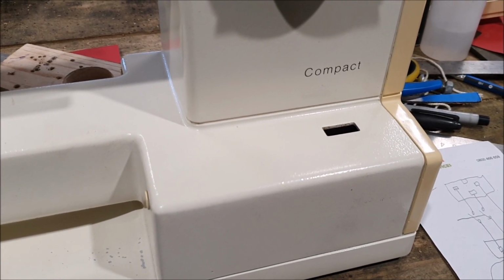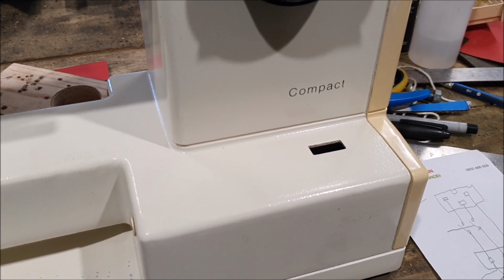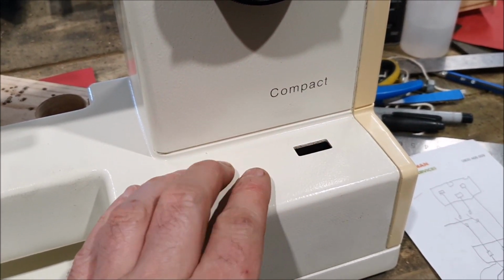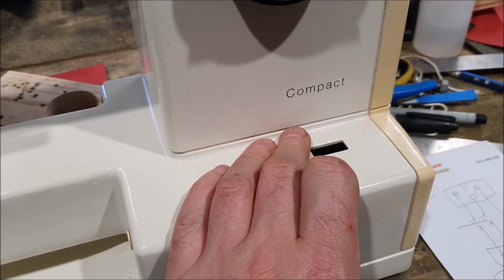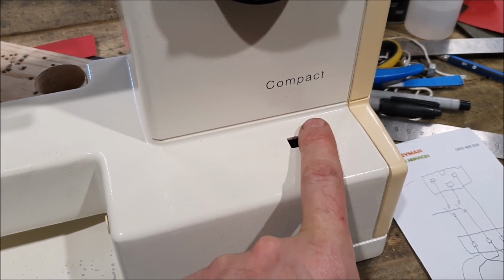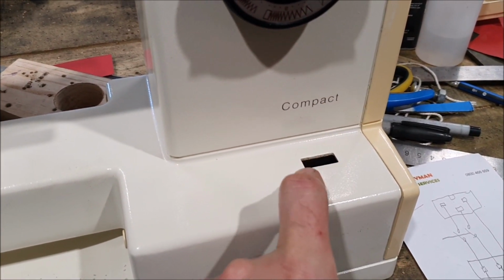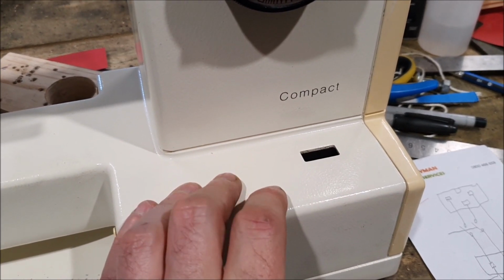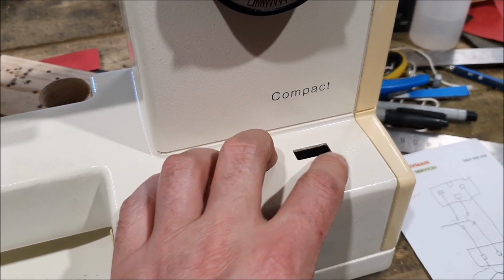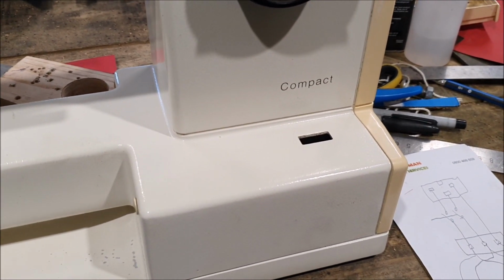So I think what I'm going to do is either look for a different sort of switch that can go in there. Probably I'll just use a simple toggle switch in there. I'll just make a little plate and just a double pole, double throw toggle switch and wire it into that. And then if somebody wants to fix it in the future with the proper switch, or if the proper switch has become available cheaply, it's easy enough to replace it, to put it back together like that. But yeah, that's really disappointing after spending all that time on it and just having it break again.